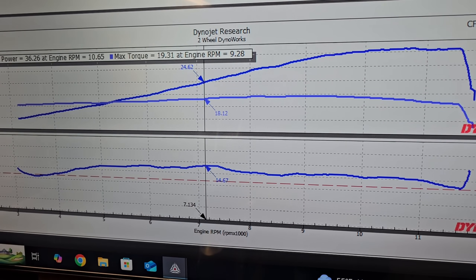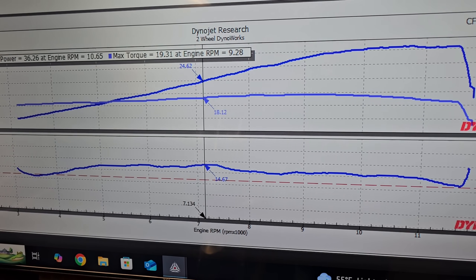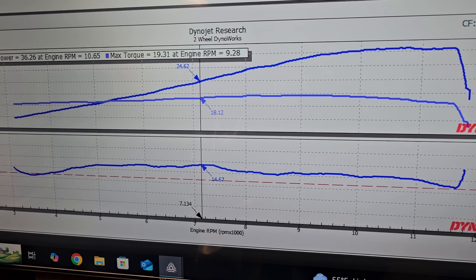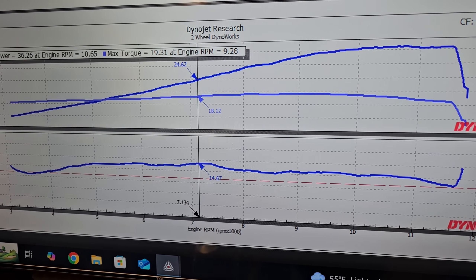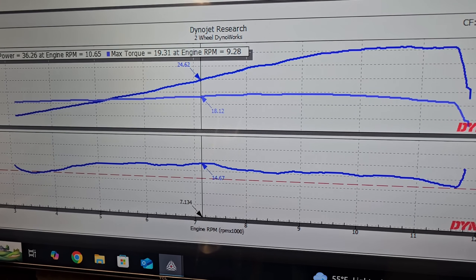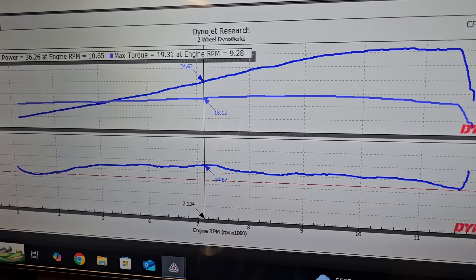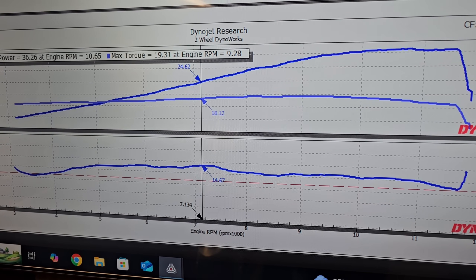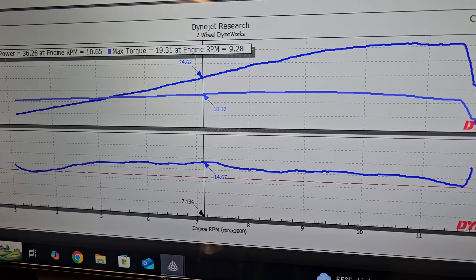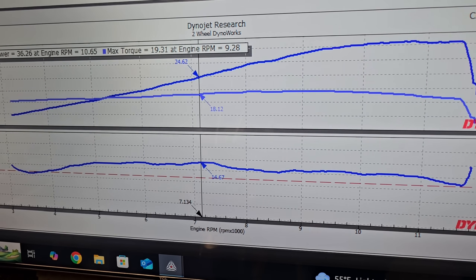The bottom graph there is the air-fuel chart. At wide open throttle, right as the bike's coming on to peak torque, it's at 14.7 to 1 air-fuel ratio, which is pretty much exactly 15% too lean. That is lean enough that it's still making pretty decent power, but it's also on what we call the spicier side of peak — meaning that's where you're going to run into things like detonation, right about that 14.7 to 1 AFR wide open throttle range. Which means that throwing a slip-on on this bike without proper tuning — not from a power standpoint, but from a safety standpoint — is objectively a bad idea.